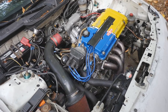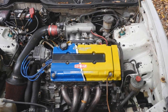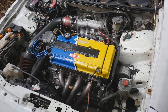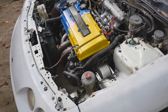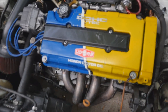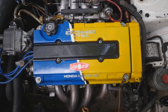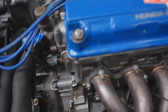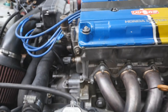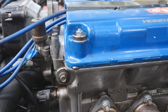The first thing we did was fix the timing because my distributor — I thought you just slap it on and that's it. Apparently you've got to turn it left or right depending on your timing setup and how you want the car to run. So we adjusted it a bit. He brought a timing light, shined it on the crank pulley, and told me the lines had to match up — and then it was spot on. We also tightened all the motor mounts and everything else that was loose.